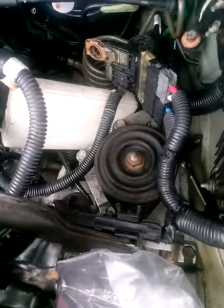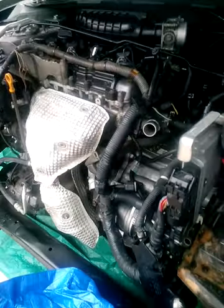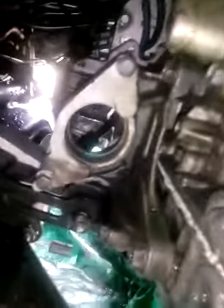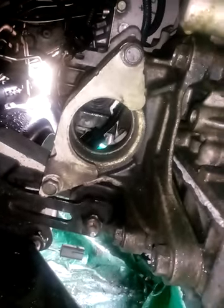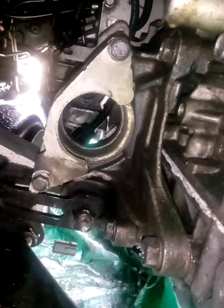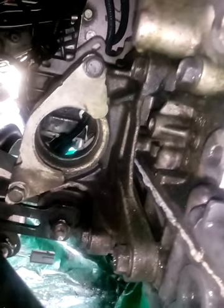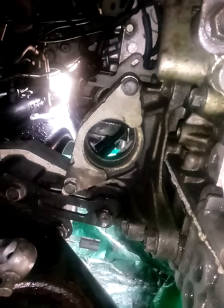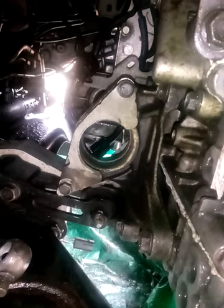What I just found out yesterday is that the axles are different. Your passenger side axle has a bearing holder — see that right there? That holds your axle in place. The CVT bracket is different than the manual bracket. I didn't have it, but I can get it at the dealer for 80 bucks. If you're going from automatic to stick, this has to be changed. You have to use the six-speed axles — I'm just buying brand new ones since I changed everything on this car.